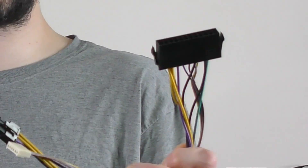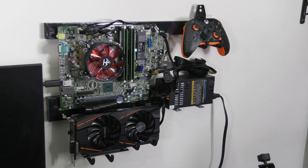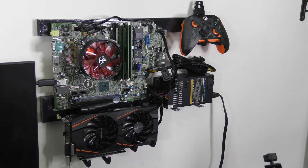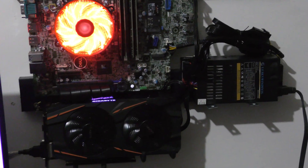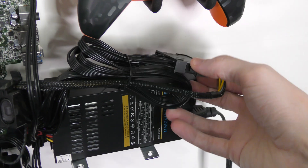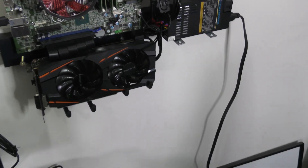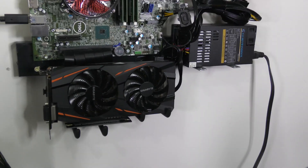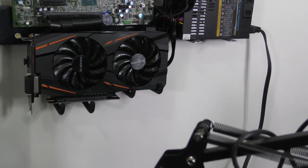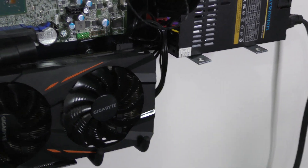In this video, I'm going to focus on this adapter targeted towards older HP models, which I haven't specifically tried before. But this won't be my first time using one of these types of adapters. I've used them in a couple videos in the past, including the last video on this channel when I created a basic homemade open wall mount — I used the Dell variation of this adapter. In that video, I used this motherboard from an older small form factor Optiplex model, and thanks to the adapter, I was able to add a PSU with a GPU power connector that allowed me to run this RX 570. A very low-cost budget GPU, which ties everything together for a tidy little budget machine.